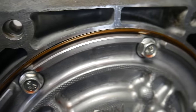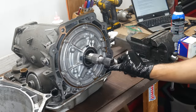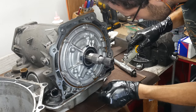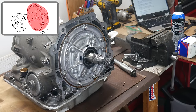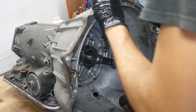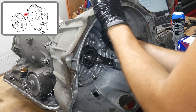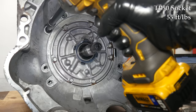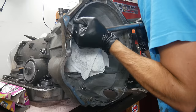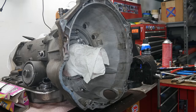The next step is to reinstall the removable bell housing. With this type of oil pump seal, tightening down the bell housing on top of it will compress it into place. We also probably should have installed the bell housing before the oil pan seal, because there's a little bit of the edge of the gasket that's squished out and is in the way — but that's no problem, we'll just trim that off and keep moving. With a clean flange surface, we can place the bell housing back onto the transmission. The oil pump is what centers the bell housing, but it does have a little bit of play left to right. Try to get everything centered as possible and get all the bolts threaded in before tightening anything down. We'll put a bit of blue Loctite on each of these bolts and tighten them down using a Torx Plus socket. Once they're all snug, we'll go around in two passes and torque them all to spec. These bolts need to be pretty tight, so keep the extension and torque wrench as straight as possible.